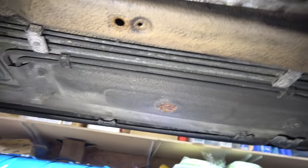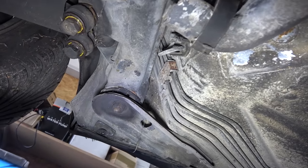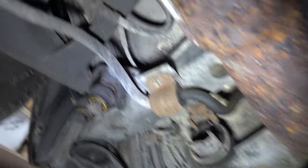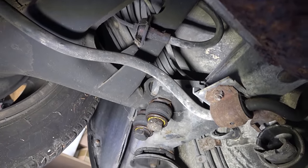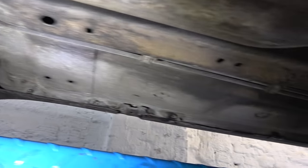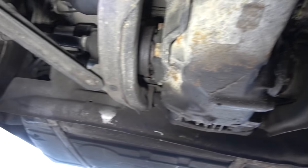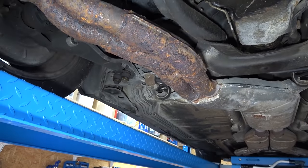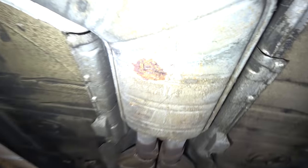All of this will need to be cleaned first, then the car needs to run for a while and we'll see how many oil leaks we have. We have a rusty exhaust pipe — but honestly this is just the shield. The floor actually looks good. Oh no, we have a bit of rust here on the drain plug hole. You can feel the floor there — the cap is missing, so that needs to be scrubbed down, but it's not too bad. This floor here looks perfect. Oh, we have an exhaust hanger that's not in its place. These ball joints are shot — really shot. Tunnel looks pretty solid.